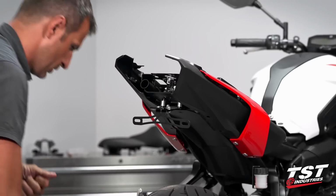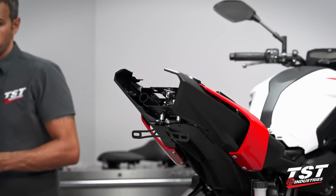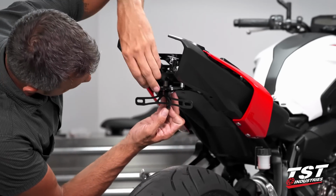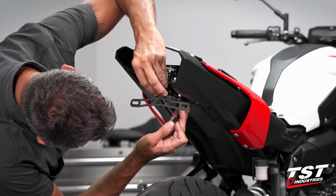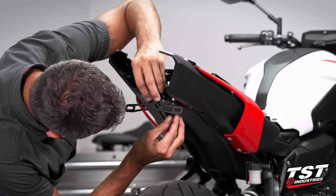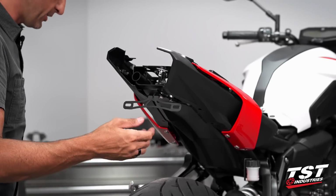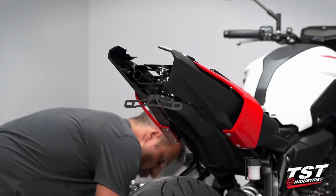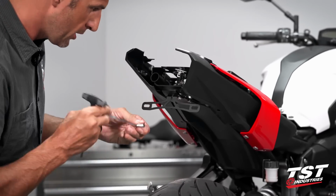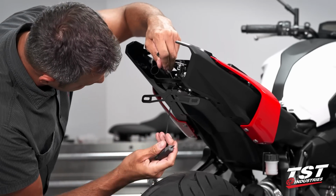And at this point, I like to replace one of the push fasteners that we took out. Reset it. And then that tab that I just showed you, I went up above this plastic panel, has a hole in it, and this little push pin connects it together, and this will make it vastly easier to complete the assembly from this point forward with that in. So 8mm box wrench and a 3mm Allen.